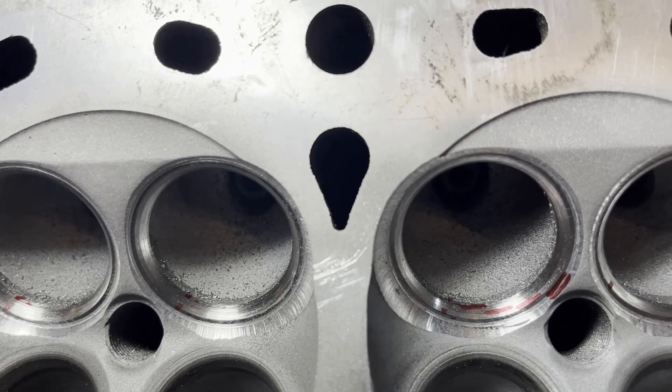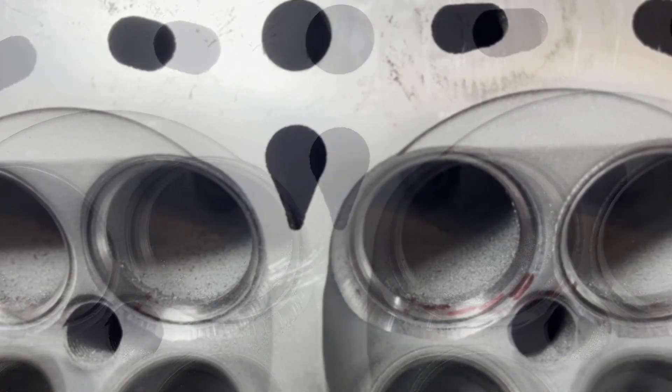And this is the result. Here I have one of my four angle valve seats for the intake sides on display. The lines show where each angle on the seat rests. You can also see how the top 30 degree angle on the seat is blended into the combustion chamber to dishroud the larger valve.